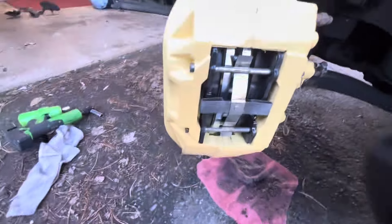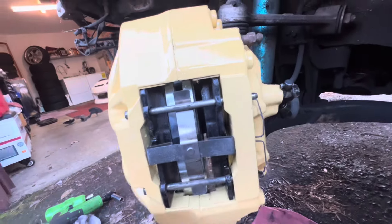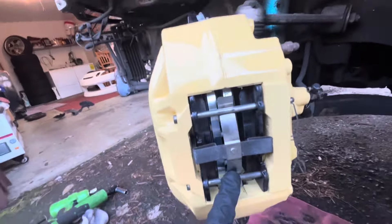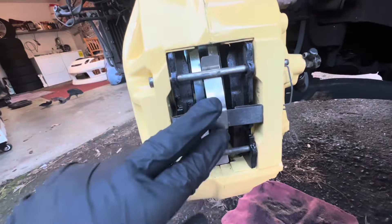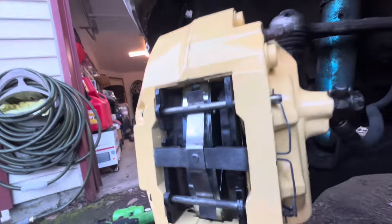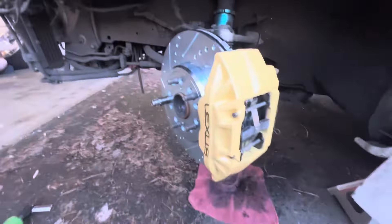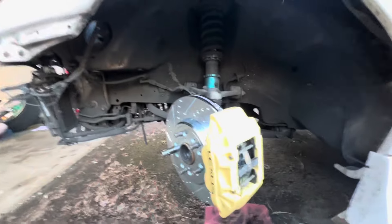The assembly of the brake caliper itself is very simple. You take the little pin out, take the rods out, take the pads out, and put them back in. The pads slide in first, then you put the big metal tab down, which is held down by the slide pins. You slide the pins in while putting pressure on the tab to hold it in place after both brake pads are in, then line up the pins with the holes and the clip through the hole and the two slide pin holes. Very simple and straightforward. Then just make sure everything clears with your wheel setup and angle kit setup.